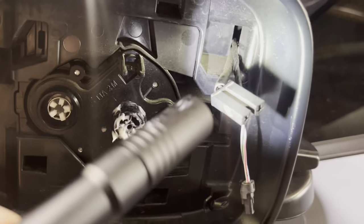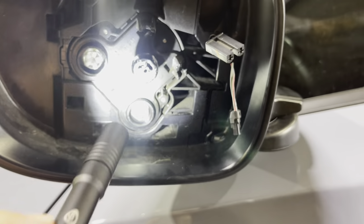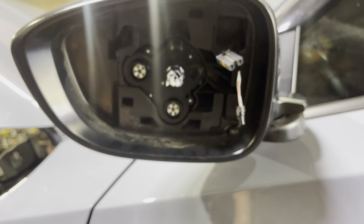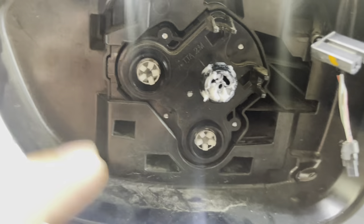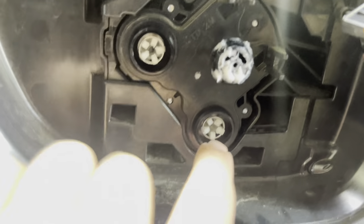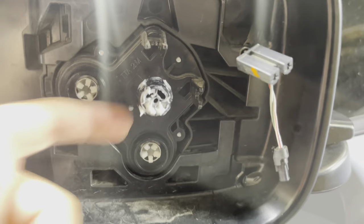So after that, we're going to plug this back into the mirror and this back into the mirror. If you do have these plugs, make sure you plug in both of those. See how that little metal retainer — that little spring — is still on that one and that one. After we plug it back in, I usually like to put pressure in the middle of the mirror to get this big tooth to pop in. The teeth that go in here — or the thread that goes in here and here — look from the front through the gap to make sure they're lining up to make sure they actually pop in there and not towards the side or bent inward or outward.